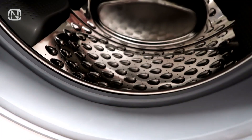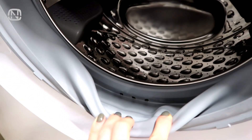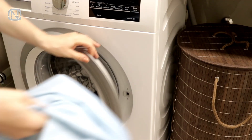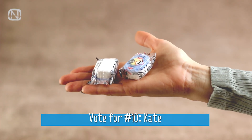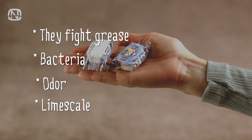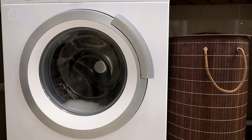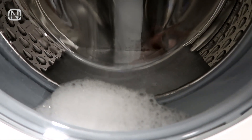Did you know that all kinds of bacteria and body funk from our clothes accumulate inside the rubber sealant pipes of a washing machine? When the machine is set to cold water, fatty acids don't dissolve completely, which can lead to growing bacteria and an unpleasant odor. This can be solved with a dishwasher tablet — they fight grease, bacteria, and odor and clean the inner drum. Throw a couple of tablets inside the machine and set it to maximum temperature (75 degrees in this case). Repeat the procedure as needed, about one to four times a year.